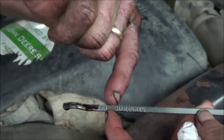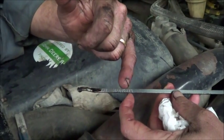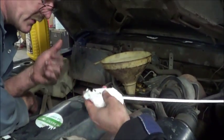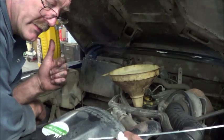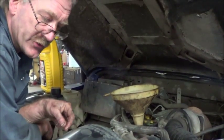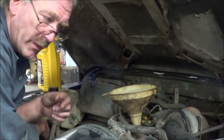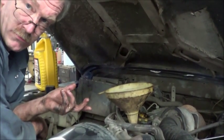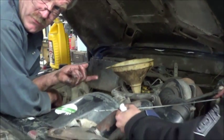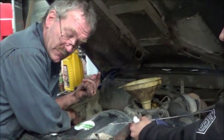What happens with danger? Well, basically you've overfilled it with oil. In an extreme circumstance, what actually happens is that the oil is forced up and it will go into the cylinders, and because this is a diesel engine, the oil will act as a fuel and the engine will start to burn the oil — because it will combust.